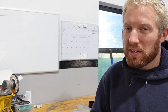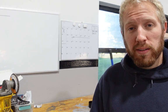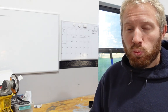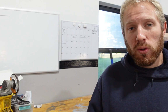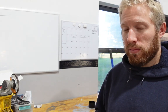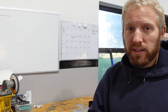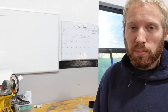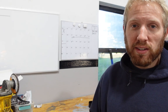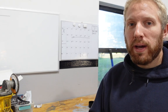I was also thinking about welding into the chassis, but I was torn because if I don't like this battery, or if this battery doesn't last or something like that, and I want to go to a different brand, I wouldn't want to have a box actually welded into the chassis that was designed specifically for this battery size. So if I decide that this battery doesn't work for this car in the future, and I need to go to like a Braille battery or a different kind of battery, I can still use those mounting points that I welded into the chassis, and I can just build a new box based on that because there's enough room around it to go to a bigger battery.